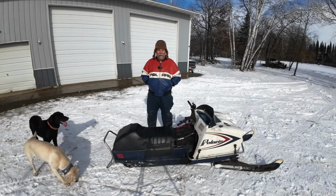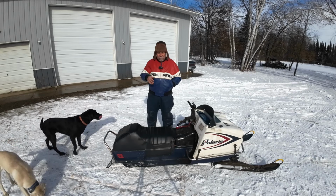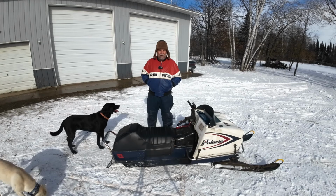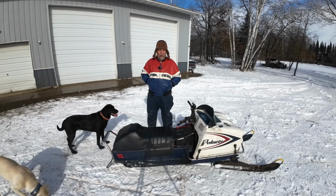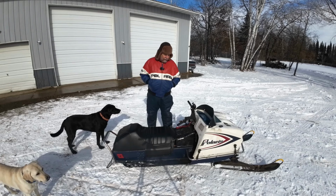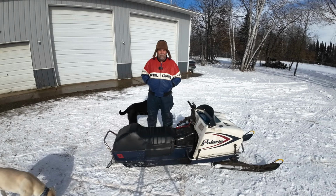Right? You saw those first passes, my first test runs, and you know me, I can't leave well enough alone. It was running, it wasn't great. I've done some tuning. I've changed the pilot significantly. I've changed the main jet significantly. That's really it. All I've done is carb tuning. I did put some fresher gas in it, and she feels way, way, way better. So we're gonna go out and do some more test hits and run around the yard.